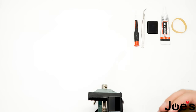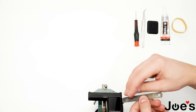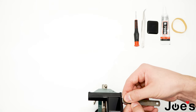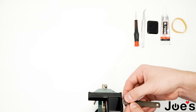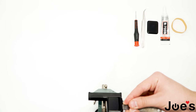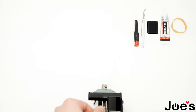I usually start where the crown is — go in there like so. When it's all heated up it should be really nice and easy to get in. Don't push all the way down because you could damage the force touch sensor, so just apply a little bit of pressure and start going around. Don't go too deep inside because you can damage the internals of the watch.